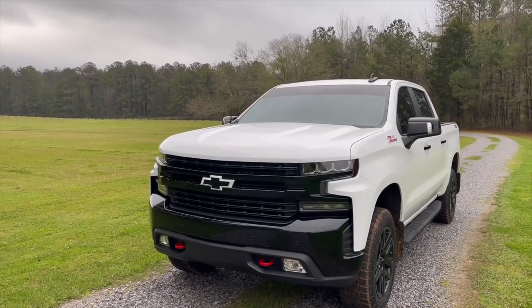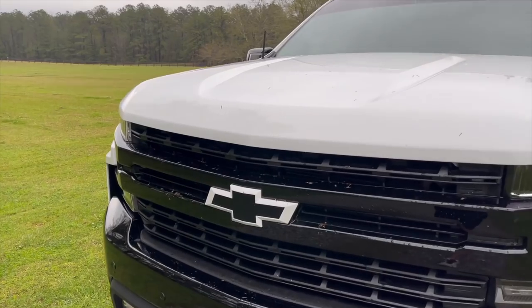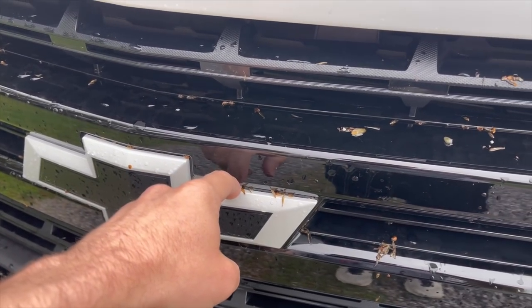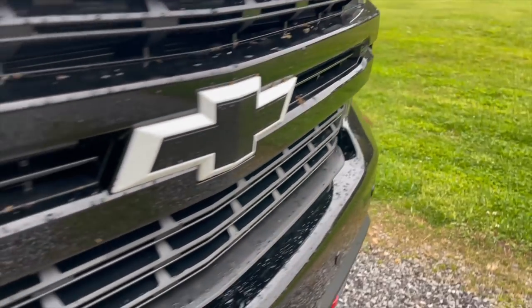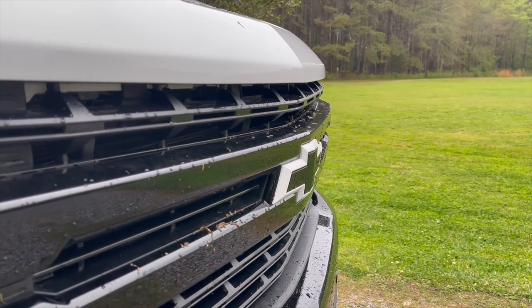I'll link a video in the description where I show y'all exactly how to take the grill out. You can just take a pry without taking the grill out, take a pry behind here and wedge this and pop it out. But it's a little forceful. I'd recommend that if you have a chrome grill, but if you have a painted grill, it's probably a little hard on the truck, and you don't really want to scratch your paint up on the grill.